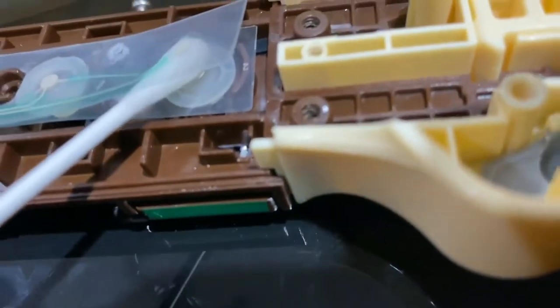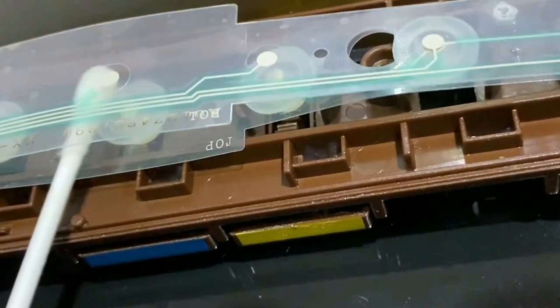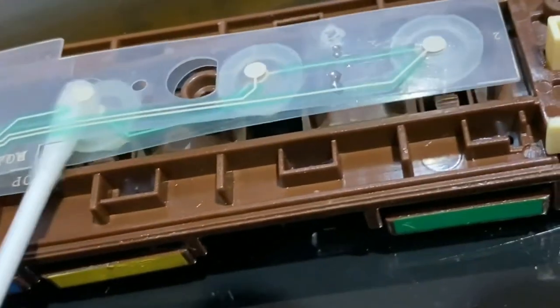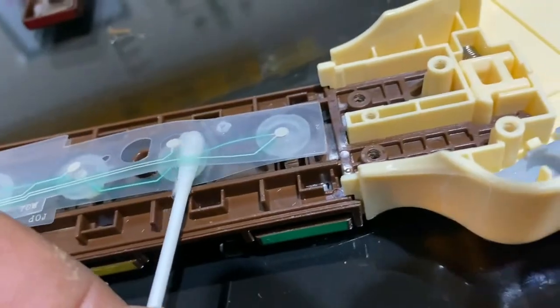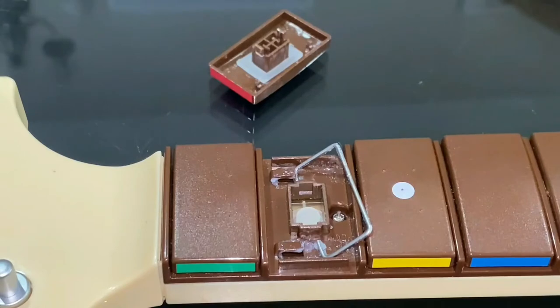Let's get it in between the main membrane here. This is the contact for the buttons — a plastic membrane. Just got to clean the contacts inside, as you can see here. There's two layers; you've got to get in between it and clean the contacts with non-harsh cleaners. Like I said, I'm using platen cleaner, and then I used a bit of tissue just to dry off. Give it a little cleaning fluid, and now that's done.